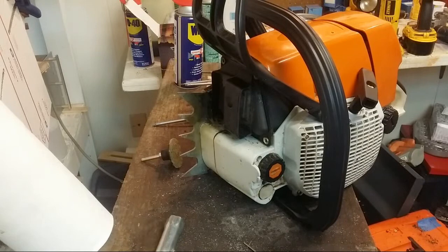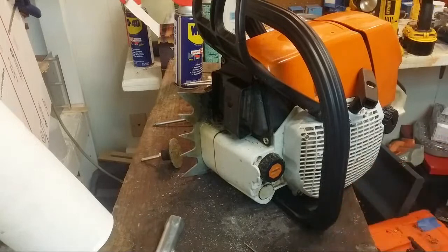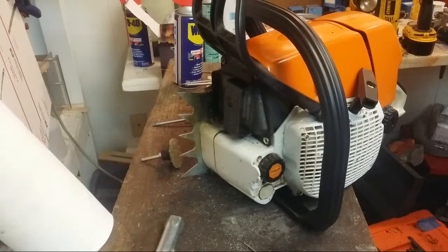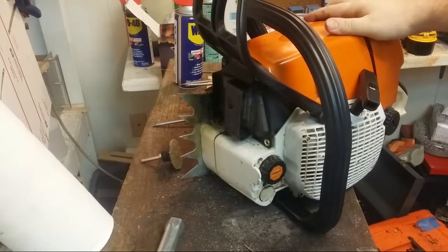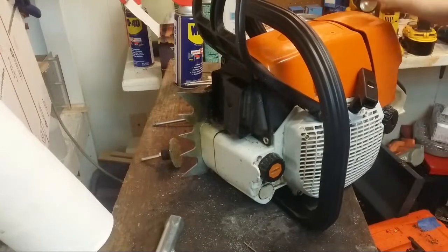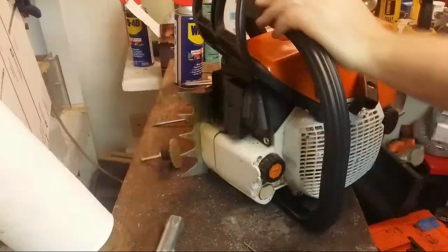There it is. Now, if I can get Mason over here, he can take it and do his thing. So this is a 54 millimeter top end. I don't know exactly what the CC is, but for sure it's going to be something. And 200 pounds of compression is probably not out of the realm of possible when this is broken in. Tight. Everything's back together. We'll see what Mason thinks and kind of go from there.